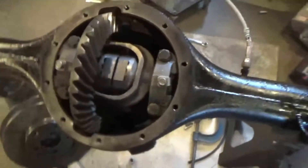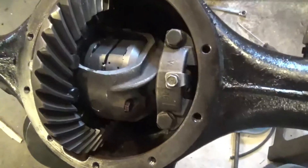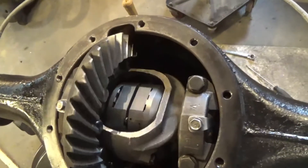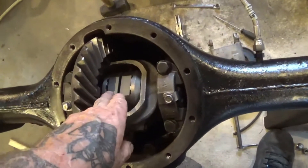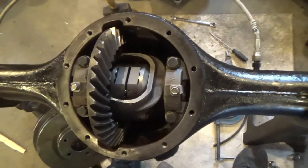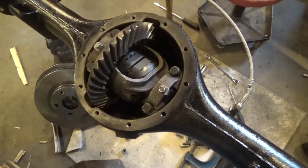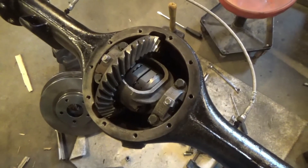Holy crap, was that difficult. Now it has a Spartan locker in it, and putting that little piece in there was a nightmare — bleeding from everywhere. I just couldn't get it in by myself, so I had to get my son to come and hold a screwdriver to hold this piece over because it just kept falling down. And if it falls down, the C-clip falls off the axle. No instructions on this one either — they had instructions for every other type but not this one. Went online and couldn't even find the instructions. I didn't bother filming that because there would have been way too much swearing.